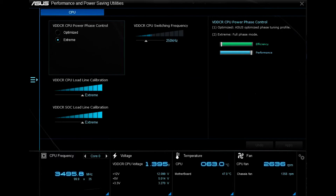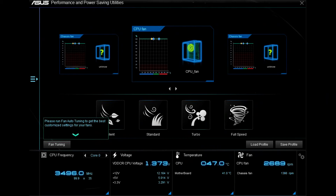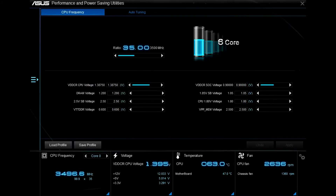For audio it has an ALC 8-channel high-definition audio codec, which works great in my use — even for microphone input — without much internal noise, which is usually a problem with motherboard ports. It has four SATA ports, all 6 Gbps. I'm using one for SSD, one for hard disk, and one for optical drive, with one spare. Another great thing with ASUS motherboards is you get AI Suite 3, which lets you control CPU and case fan speeds, LED lighting, overclocking, CPU calibration, and BIOS updates — all from within Windows.